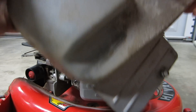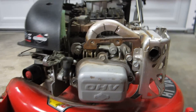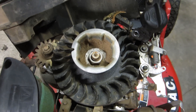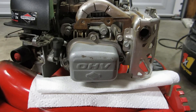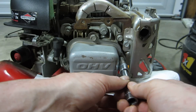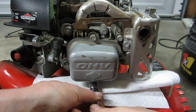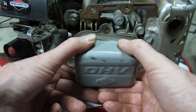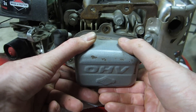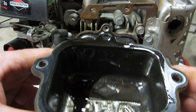The cover is off and it doesn't look too bad. It pulls easy. I don't really see a problem - it doesn't look that dirty, just a little bit of debris. I'm gonna clean all this off, tie off the blade brake, get the spark plug out, and take this valve cover off. These are three-eighths bolts. I want to try to save this gasket. Hard to tell if this has ever been off before - the bolts were tight. I don't believe that cover's ever been off. Bolts are out and I'm gonna be very careful taking this off.